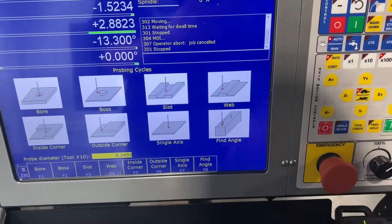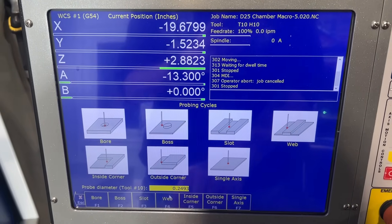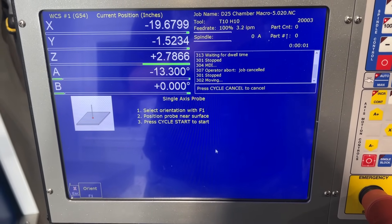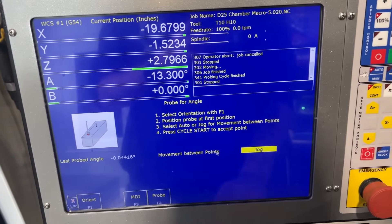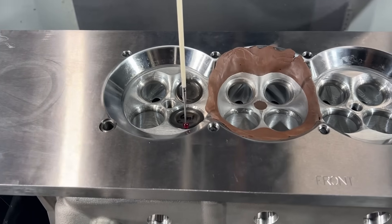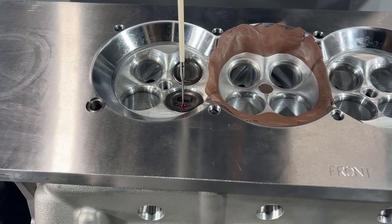One thing that was super important is to find the valve angle on the cylinder head in the machine. You don't want to just assume that because it's a Voodoo, or it's part of the family of cylinder heads, that it has all the same valve angles. So what we do is you take a valve, reface it all the way to make it razor sharp, and then you stick it in the head. It comes down with a probe and checks that. All of the geometry of the port goes off of that initial measurement.